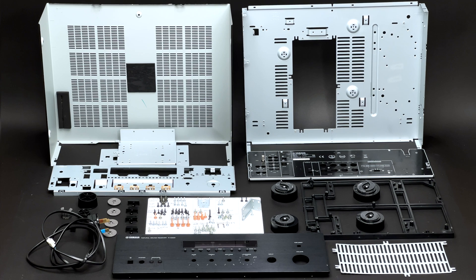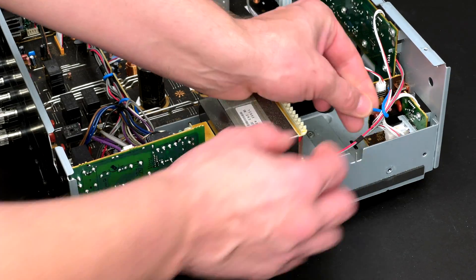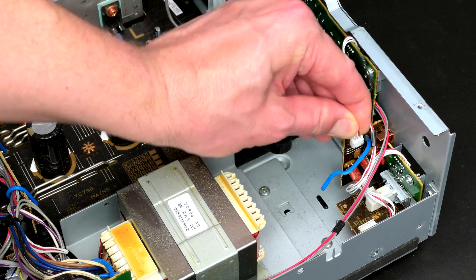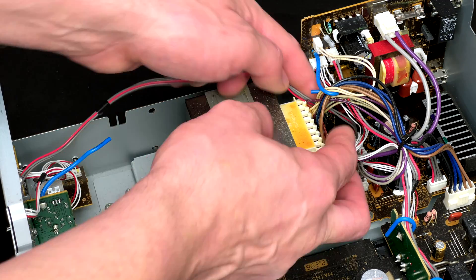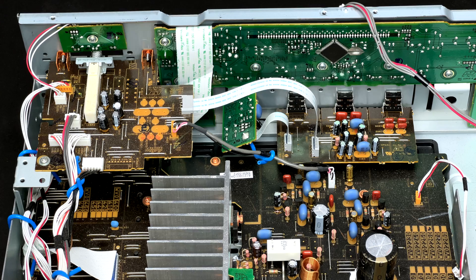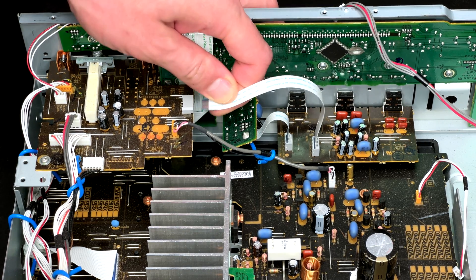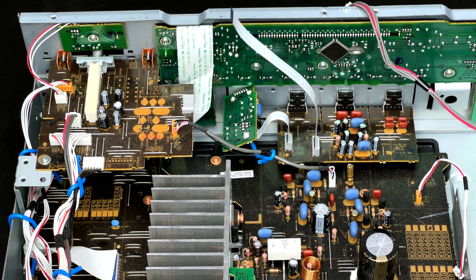I will wash all the chassis parts that I remove with soap and hot water — I find this cleaning method to be the best. Next I have to disconnect all the cables linking the sub-chassis unit with the rest of the components. First goes the headphones PCB, then the power cable for the front PCB. This ribbon cable could have been disconnected later, as it links operation PCB 2 and 3, which are attached to the sub-chassis unit.